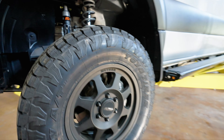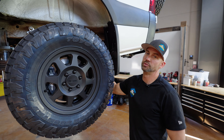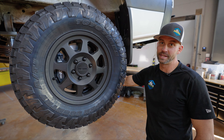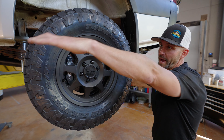Once you've addressed the front, you've got to tackle the rear. We like the RIB kit solution because you get a brand new complete leaf spring. You go from a two-leaf pack to an eight-leaf pack and about two inches of height. So now we're matching the front.